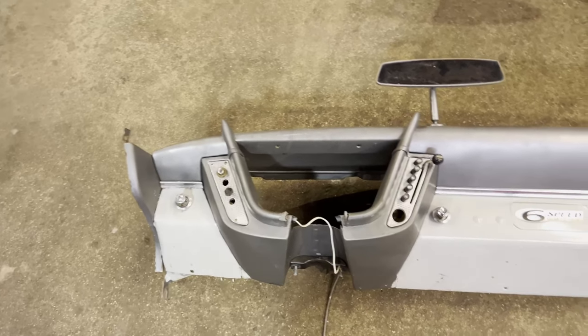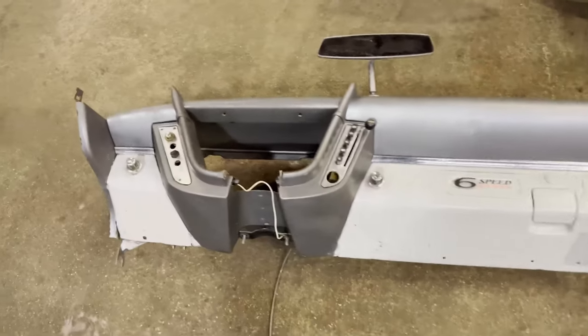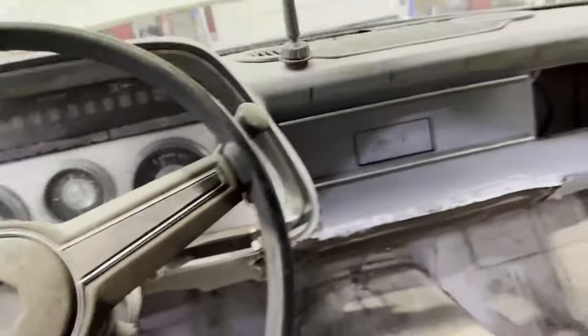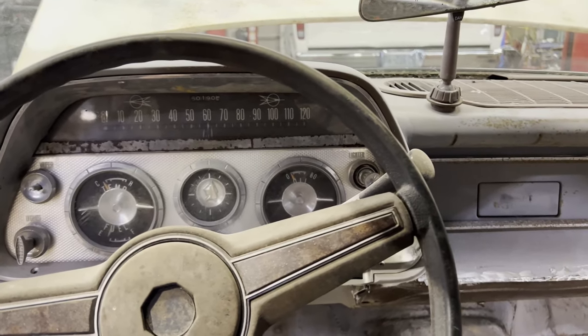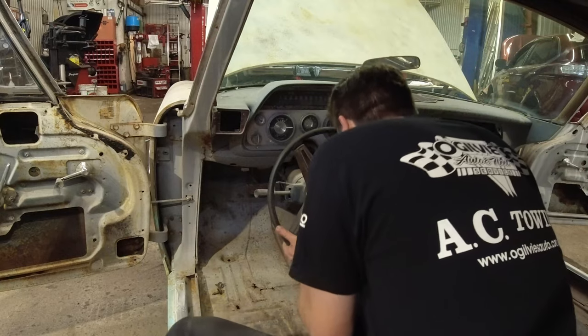I have decided it's getting our old 1959 dash — it's already been signed by a couple people. After looking at the damage done to this dash from the center console, we're gonna swap it out. I like that dash better anyway. The unfortunate thing though, someone decided they wanted to weld this dash in — it's welded there where it's supposed to be bolted in. So you have to drill those out and cut that. But at the end of the day it's gonna be worth it, because that dash just made that car and it's gonna help this car feel like that car. Let's get this out of here.